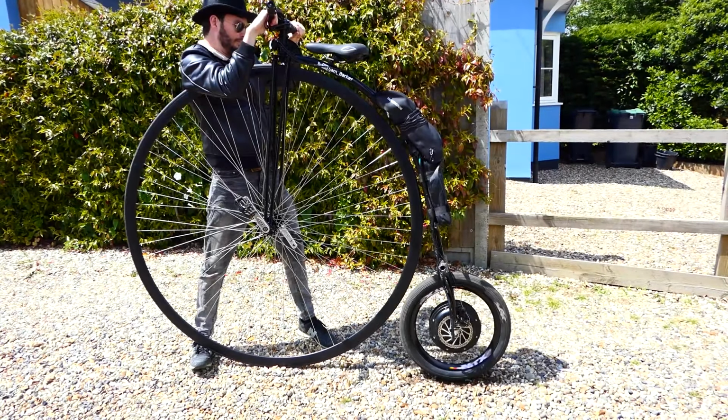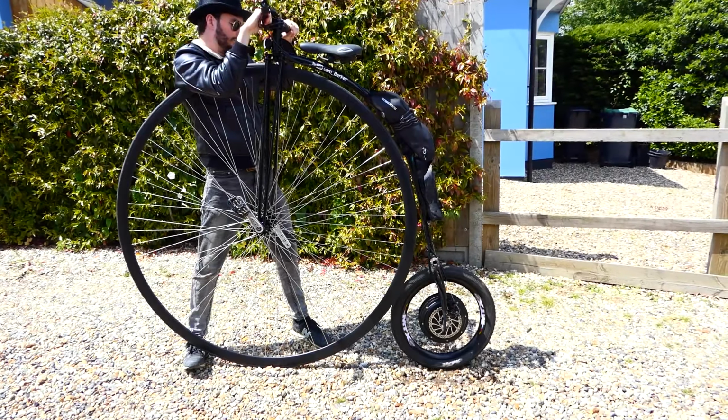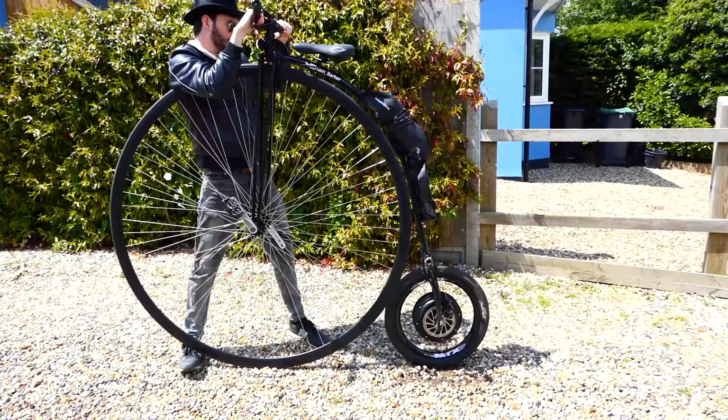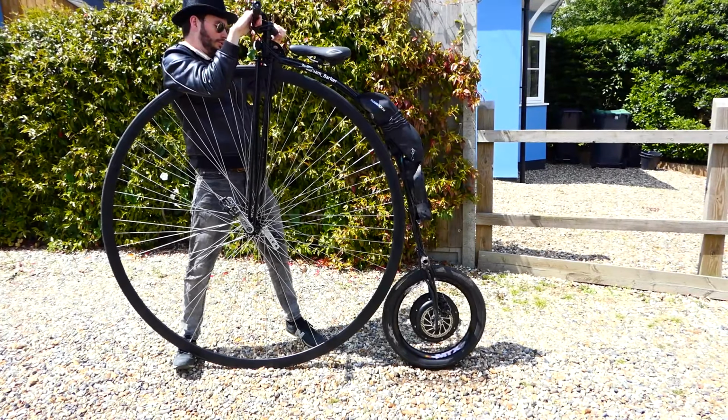I think the wobble was being caused by the flex in the frame. You can see here in the slow-mo as the wheel gets grip, it's pushing back and forwards, caused by the torque of the motor. I want to go faster in the future, so I think I'm going to manufacture my own frame to be more rigid.